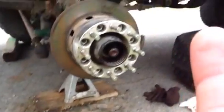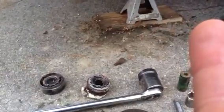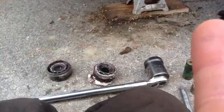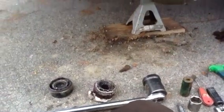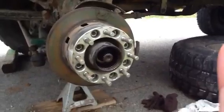They're real easy to convert as well. If you have a full-time four-wheel drive, they do make conversions — if it's an internal hub like this you can just go out and buy any internal hub and put them in, pretty simple. Also great replacements for auto-locking hubs, especially on these older GM vintage ones — the auto-locking hubs kind of suck, they put a lot of shock load on your u-joints and things like that. For the external hub design found on older vehicles or some Dodges, companies like WARN, Mile Marker, Superwinch, and now Yukon are pretty much all making hub conversions if that's something you want to do.